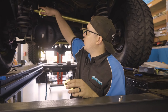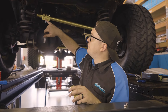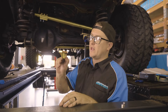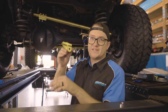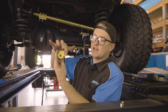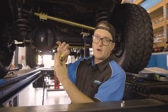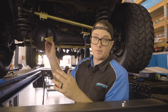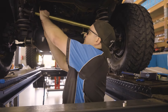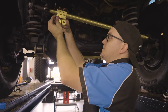So I've got all the bolts installed on the dampener bracket here. As you can see, we've got the two longer bolts holding from the forward-most positions on the driver's side of the vehicle. That way we can install our bracket where your dampener actually mounts with the tapered hole. You want to mount this so the flat side of the bracket is facing to the back of the car — that's the way the taper runs and it has to be installed that way to make sure it pulls up tight and your taper pulls through correctly. Now we can install the flat washers and nylock nuts and get this one positioned.